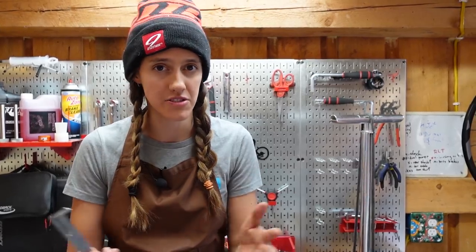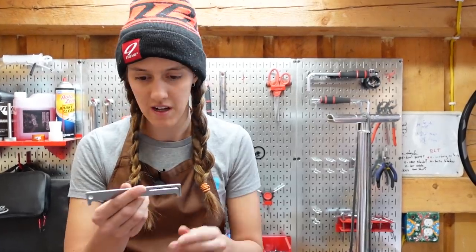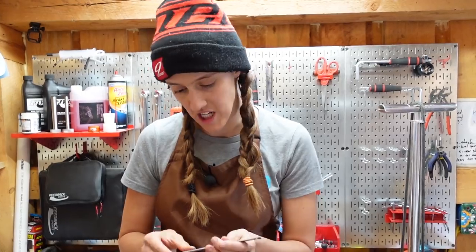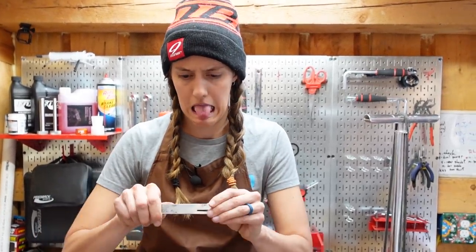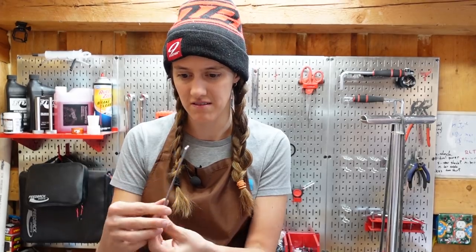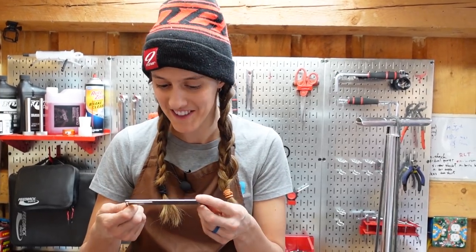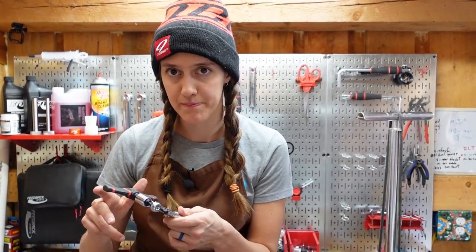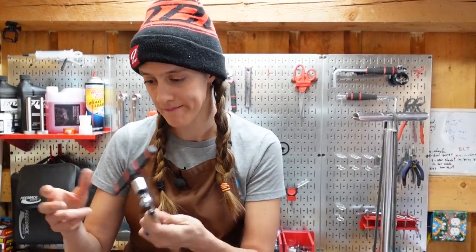The next thing you'll want to be able to do is check and replace your chain. Replacing your chain before it's super worn out can save you a lot of money on your drivetrain overall, so we think it's worth the investment of a chain wear indicator. You can do it with a ruler, but these are handy and super easy to use. They also last forever — you buy it one time and you'll never have to buy another one. It works between 8-speed and 12-speed chains, so don't worry too much about compatibility. It's also good to have a nice chain break tool, since the ones that come on multi-tools are super annoying and we've broken a bunch of those.